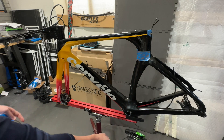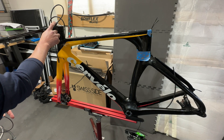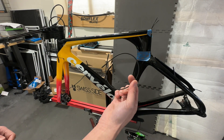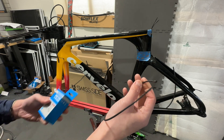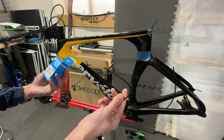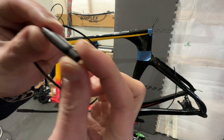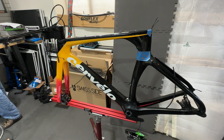I've got two options. One was to replace the SD50 that I have up here — I have a 35-centimeter wire — or I can extend the one in the back. When I purchased this SD50, I actually got the wrong part; I got the SD300. So I have to buy this part again, and I don't want to waste this SD300. Instead I brought a junction connector, which is a little bit cheaper than buying a longer wire, plus I won't throw this away, so it's less waste. The JC302 is a connector for SD300 wire, so I'll show you how to hook this up.